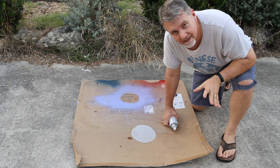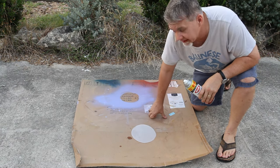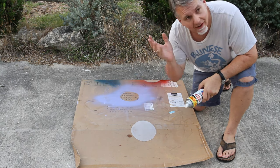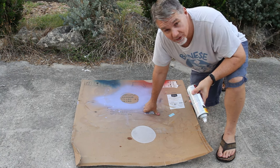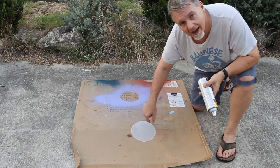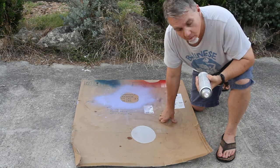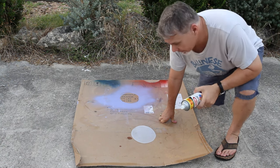Now you're thinking, okay, what's the next step? Well, the next step is a thin coat of paint to match the color of the fabric to make the light output a little more uniform. Got some basic red Color Master Krylon right here. I went through my garage and picked out the paints that I had. I didn't go out and spend any additional money on dedicated plastic-adhering paints. That's one of the reasons why we went with the random orbital sander to grit up the surface some, to give the paint a little more surface to bite onto. And we're not going to go heavy, just one relatively light coat, because we don't want to block too much light, just adjust the color of it. Okay?